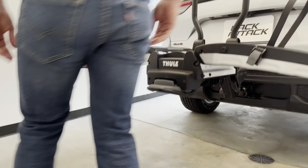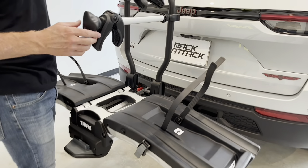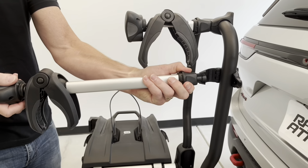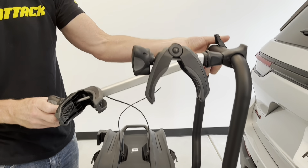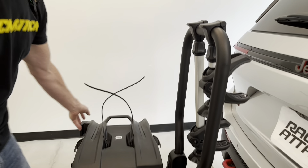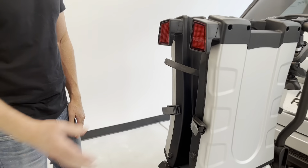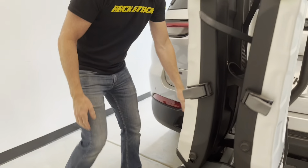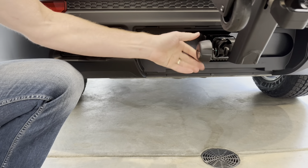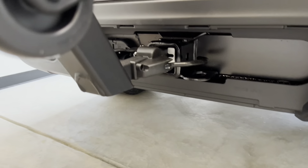Easy Fold is a reference to how the rack can be stored. So let's go ahead and put it in the stowed position. To do that, I will remove this part here, which is the support arm, and reposition it just so it's out of our way, and then tuck these down. Next, I'll just bring in the two halves of the platform. And then underneath we have this turn knob, which will release the grip from within the hitch. There's an auto pin on the opposite side. I'll go ahead and take the rack off so you can see those two features in detail.